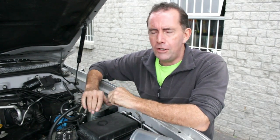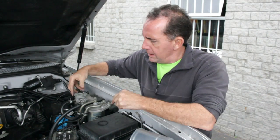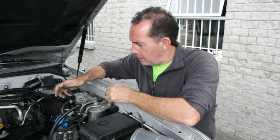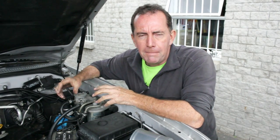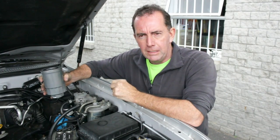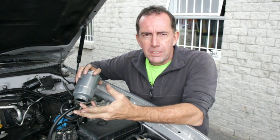At least once you've drained it, you know you've got good fuel in the tank. With new fuel filters back in, you've got to prime the system — sucking all the way from the tank through the primary filter into the secondary filter using the little plunger. Take the hose going to the injector pump off, put your finger on it, and release the air while pumping. It can also help to fill the filter up with diesel before screwing it on, so there's less air to push out. And it's always a good idea to use fuel stations with high turnover and new pumps; if you're in the middle of nowhere with an old pump, filter the fuel through a funnel before filling up.